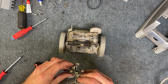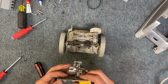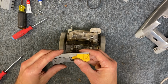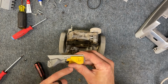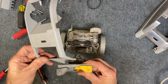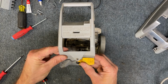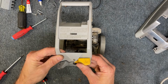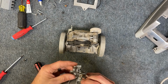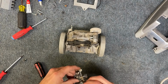And so that may be what you have to do, but once you find the right spot, what should happen is when you push the neutral, this piece here clicks in like that, it releases the gear, and then the drive, when it's locked in, is close to parallel right here. And if you've got it misaligned, the pedal is going to run into this piece here. So that's why it takes a little bit of trial and error to get it in the right spot.